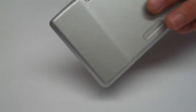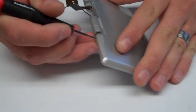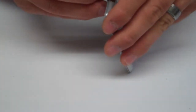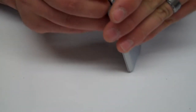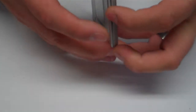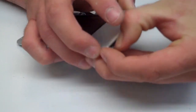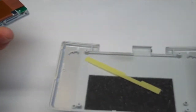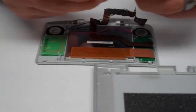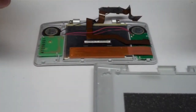To open the upper LCD half, you can use your fingernail or a small flat head screwdriver. Start on one side and lift until it opens up, then slide around with your fingernail all the way around the sides — sometimes they're a little ornery but it will come apart. There's nothing attached on the inside. If this piece falls out, make sure you insert it back into the unit as it holds your upper LCD screen in place.